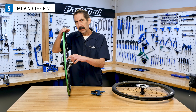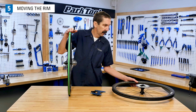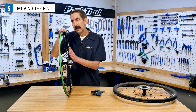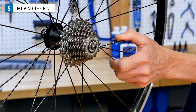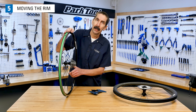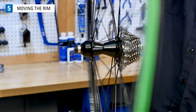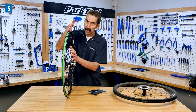On wheels where the flanges of the hub are different distances to the center of the hub, such as a rear wheel with sprockets or a front wheel with a rotor disc, you're going to see differences in left and right side spoke tension. The side that is inset or further in is going to have higher tension. You could measure it and even feel it on these wheels — this side, for example, feels tight, but squeezing the non-drive side feels looser. That's simply the engineering of these wheels and is a normal thing. This is why we pay attention to the tightness of the inset side, the tighter side — the other side will simply be lower when the dish or centering is properly set.